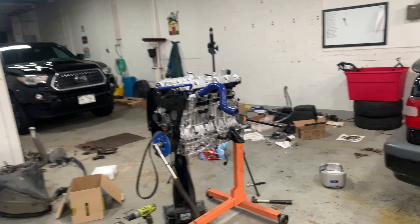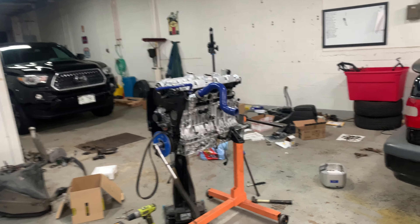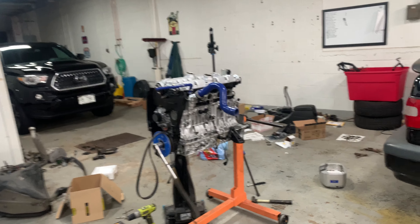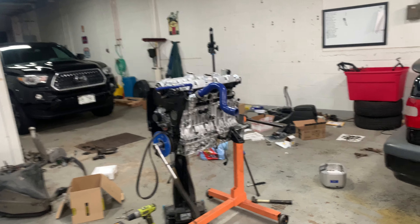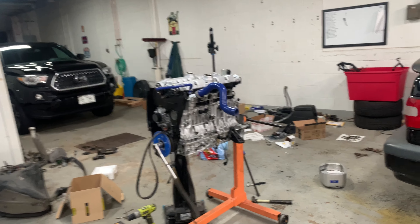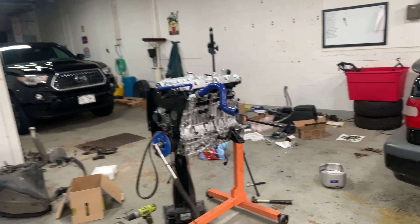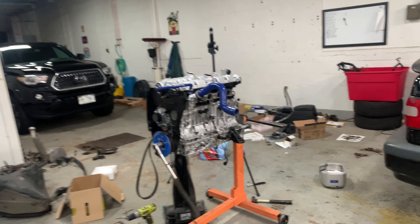I already turned the engine over a couple times and didn't detect any piston-to-valve clearance issues. I noticed my old true TDC mark was actually a little too advanced, which was causing the cams to be a little too retarded. Retarding the cams moves the power band up in the RPM, so by getting this more accurate with the degree wheel we might pick up maybe 100 RPMs of spool. Pretty happy about that. We're done timing — next step is to drill out the oil return and tap it with one-half NPT, then clean it all out and put the oil pan on.